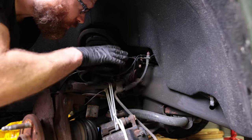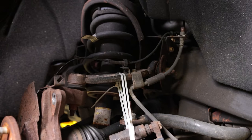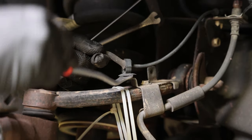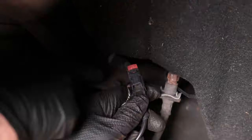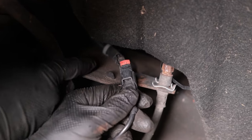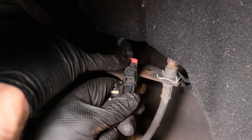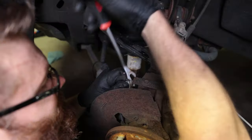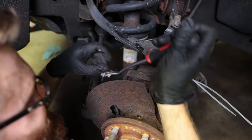The awesome thing about the Kryptonite kit is it not only includes an entire new ABS line, it also includes all new clips — so we don't even need to worry about trying to salvage the OEM clips that go into the upper control arm. I'm just going to take a pry tool and get those out. The connection point is up top; you have to get the red tab to go backwards — it can be a little stuck with age. Once you have that red tab pushed into the release position, push down the black tab in the center between the red tab and the body of the clip, and pull that apart. There's one additional connection right here and again we don't need to salvage this clip, so we're just going to get that out.